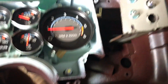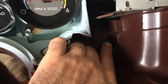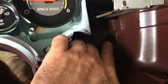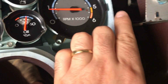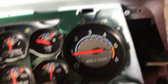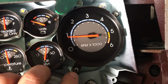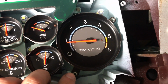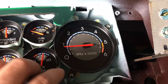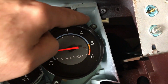Okay, a couple things to note: the passenger side mirror cable, just make sure you carefully route that through when pulling this last third sub bezel assembly off. And then also the cable for the defroster that goes through here. And then last, I don't know if maybe somebody was in here before, but these bolts that actually hold on the tach are 1/4 inch, so that adds a 1/4 inch driver to the set of tools. So there's two of those bolts, one here and one here.